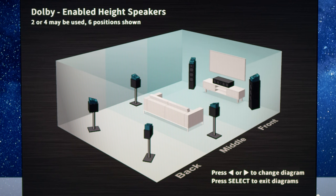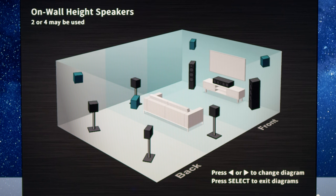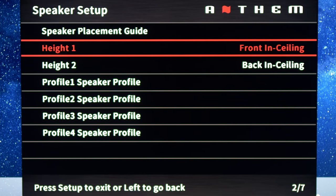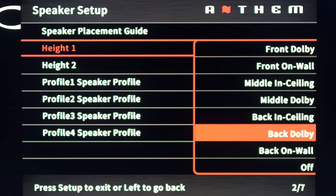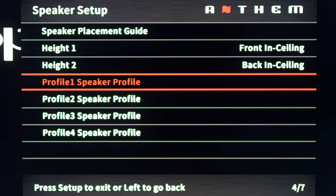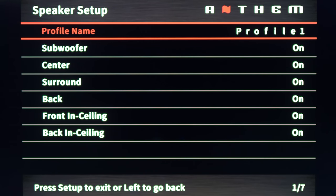Next is the same as the previous but for Dolby-enabled reflecting speakers. Then we have on-wall speakers with up to four speakers supported — I see a lot of people like to use SVS elevation speakers for just this kind of setup. Once you get the layout you'll be using, just hit enter on the remote to select it. Since I'm using height speakers, this option lets you choose in what position the heights will be used — just scroll down the list and select your location type. Mine is front ceiling, and height two is back ceiling.